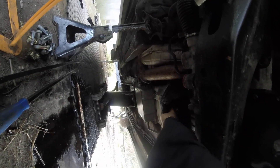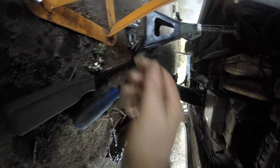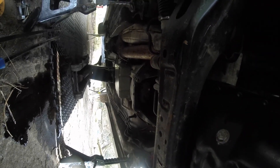Once you've done that, the torque converter is bolted in here — there's actually a little inspection hole with a cover you have to take off. The torque converter bolts, I think there are six of them in total — tiny little things. Once you take all of them off the box will start to separate. I've got it supported by a trolley jack, then I'm just going to lower it down. The box starts to separate — give it a wiggle and just hope for the best.